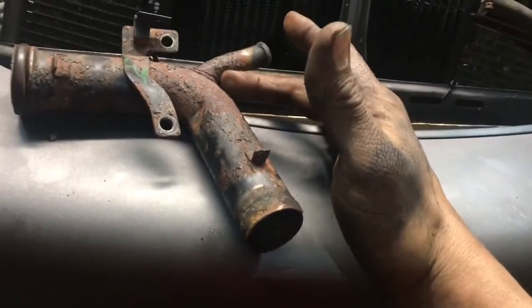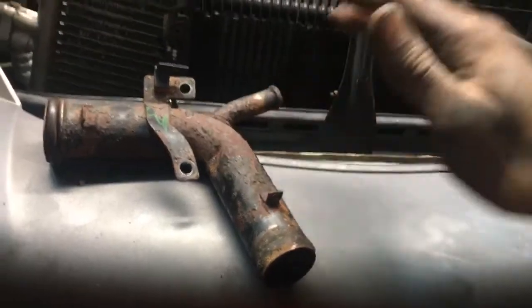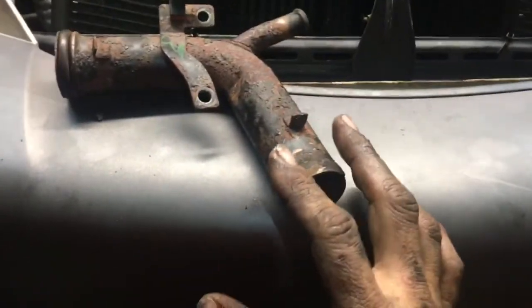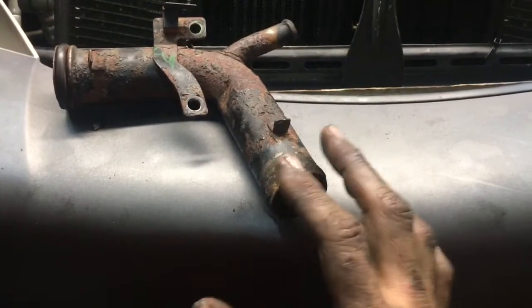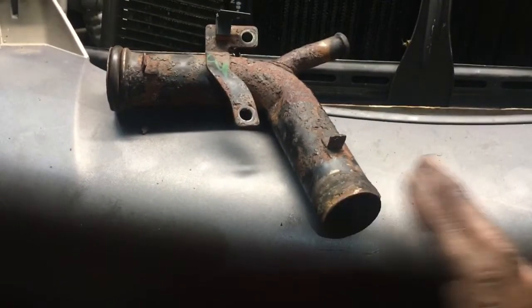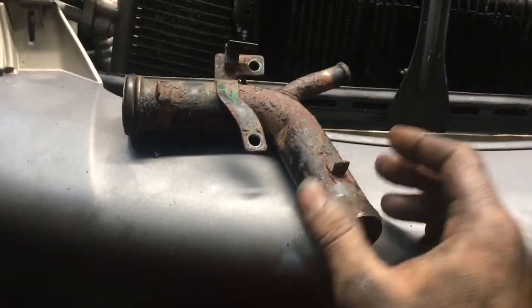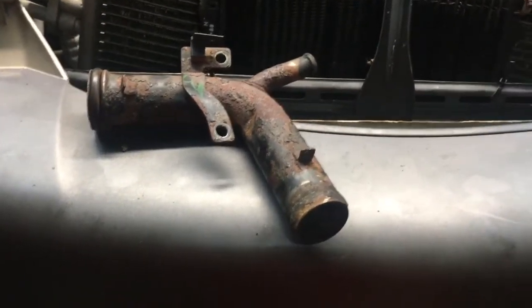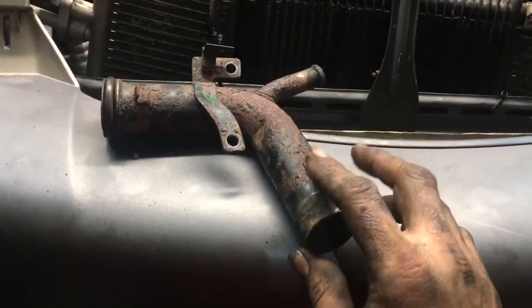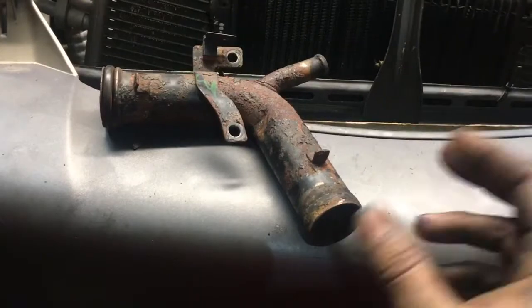Hopefully you put the hose on first. The hose can be down here if you want, but just make sure it's started and everything's tight. Make sure that you put this lower radiator hose on before you put everything back together — because it's not so easy to get on with the radiator in. I ended up removing the radiator just to put this hose on, and I wasn't very happy about that.